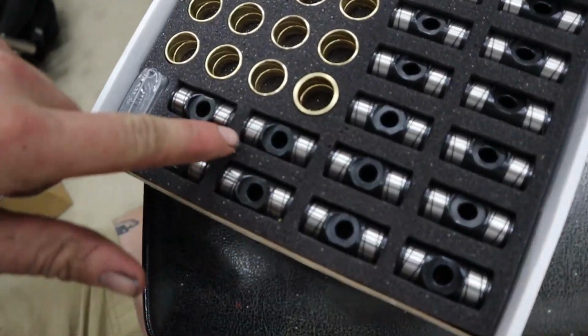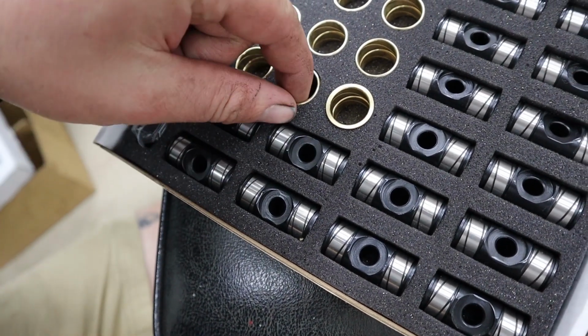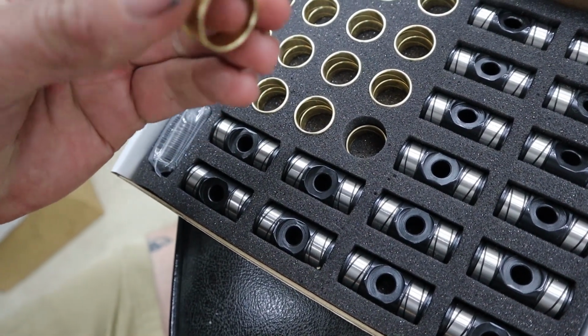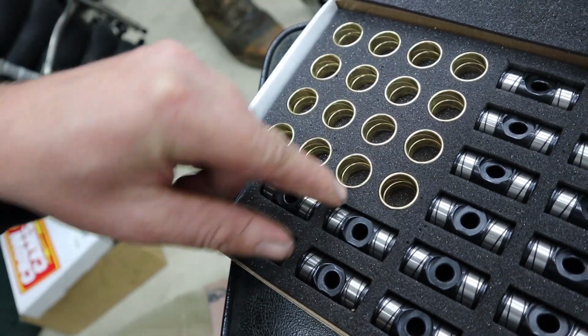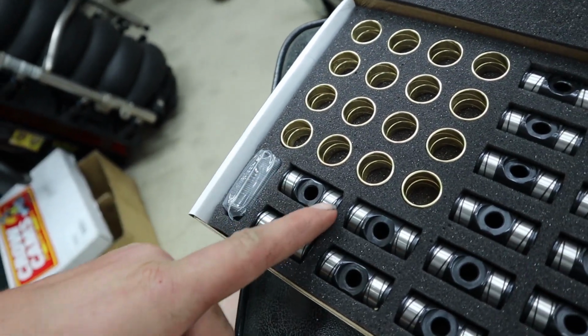But as you can see, the grooves in the trunnion arm will actually work oil out into the bush. As you can see, they are sort of somewhat designed to ensure that the oil works its way out the bush through the trunnion arm, whereas the generic white box ones are not. They're just a straight oil groove line.